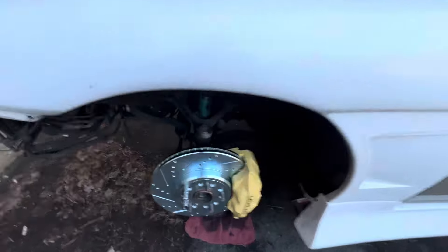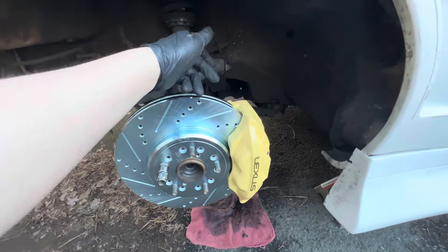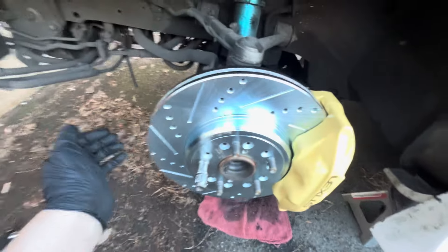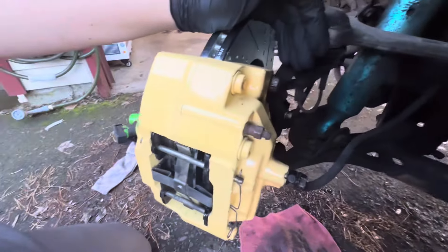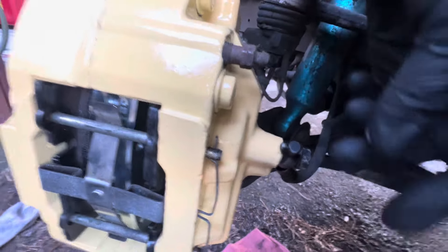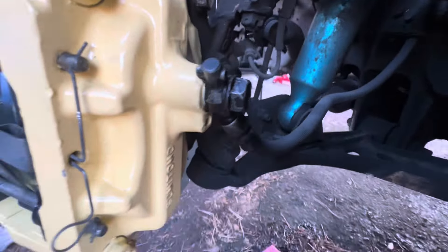Let's go over some info real quick. Everything lines up perfectly with the stock SC knuckle. You need to utilize the LS400 caliper bolts — do not use your SC caliper bolts because they are a little too long and will rub into the brake rotor. I like to torque the main 17mm bolts down to about 75-80 foot pounds. You can put some Loctite on if you prefer and don't have a torque wrench. Also, the safety knob for the brake line doesn't line up well with the hole on the LS400 caliper — if you have an angle kit, at full lock it could possibly pull on the line and not give you enough length. I just turned it up and tightened it down.